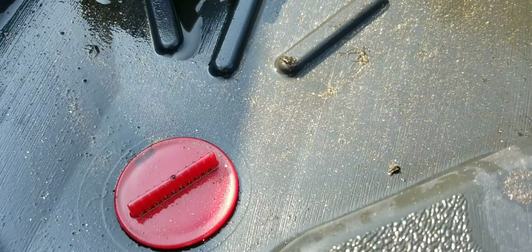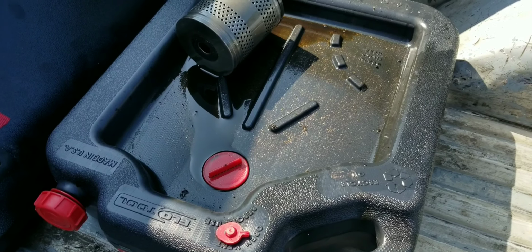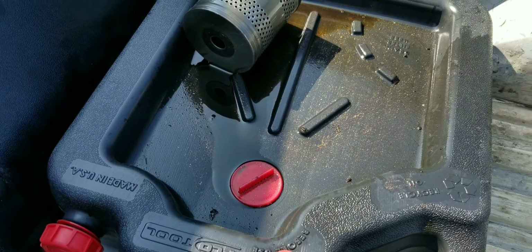There's no knocking noise, so I'm really not believing that this is going to be a bottom end bearing. I believe this is from the cam. But we're discussing now whether we want to attempt to remove this engine and rebuild it, or if I'm going to try to source them another engine for this bus. And there's also a possibility that the bus might get parted out or scrapped. So we'll have to see what the customer decides.